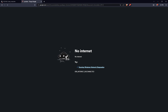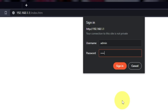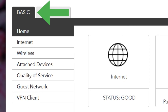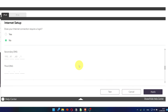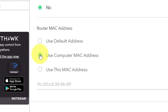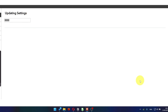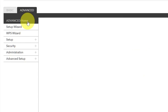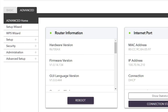If it has failed, check all the cables — they must be connected correctly. Then log into the router control panel again. Go to Basic, then Internet, and choose 'Use Computer MAC address'. Click Apply, then reboot the router again: go to Advanced, Advanced Home, click the reboot button, and click Yes. After restarting, wait a few minutes and try Googling something.